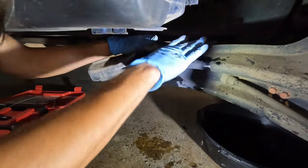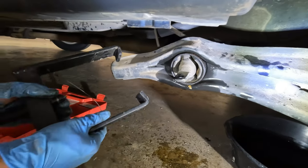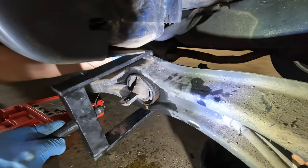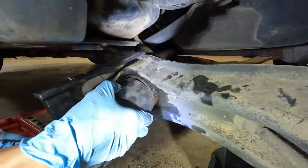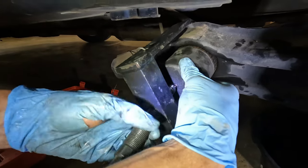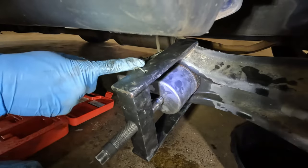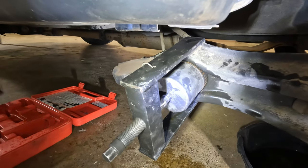The way this tool works is we're going to slip the claw over the back of the trailing arm — it hooks into the back of the trailing arm right here. Then you're going to take the cup and put it simply right over the trailing arm, just like that. Then we're just going to screw until it gets tight and use the tool to extract it. Make sure it's perfectly centered and that you use some sort of lubricant on the back side and the front side of the bushing.